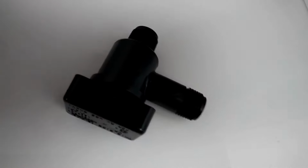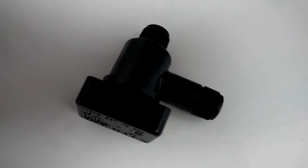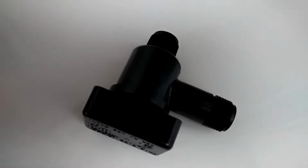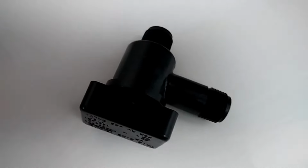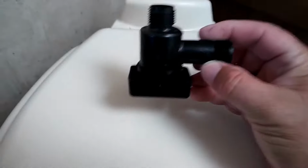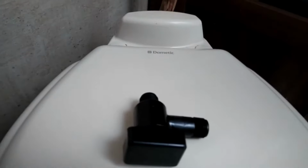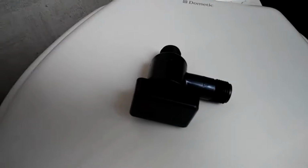It got really nasty in here because the tank was venting inside the camper. The other valve came apart or something internally, and when I engaged it to flush the black water tank, it started flooding the bottom of our camper. So I had to shut it down and take it apart, and it took a little bit to figure out what the heck it was. Evidently there have been some problems with this valve in other campers.